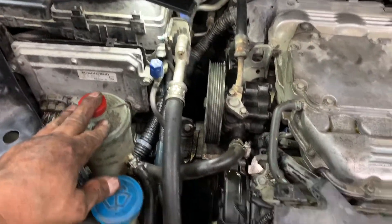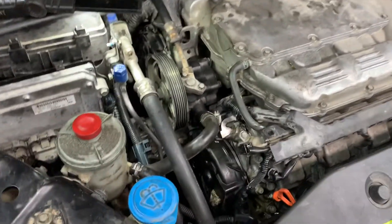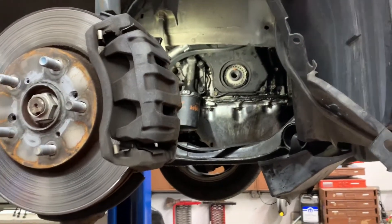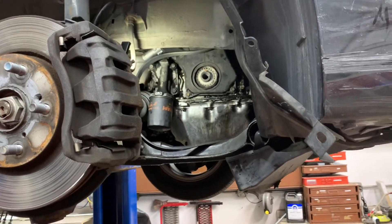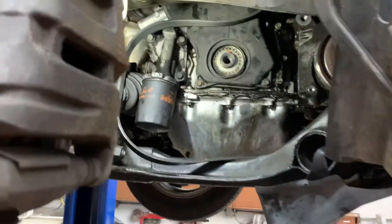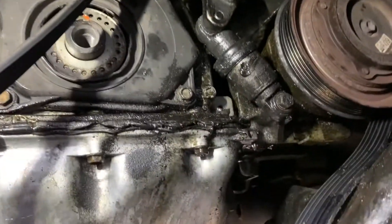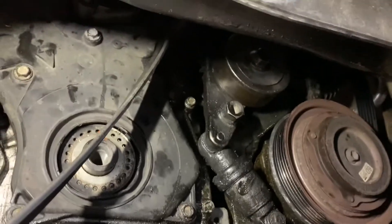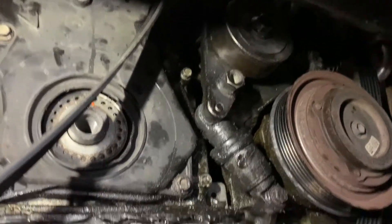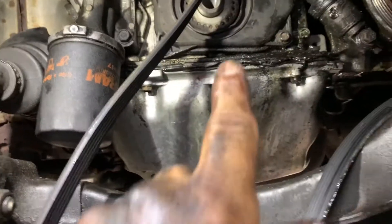Power steering pump is on. Now connect the power steering pressure hose with the 21s, then put on the reservoir. The reservoir's on, hose is connected, clamps are on. Put some fluid in it so you don't forget and aren't pumping air. Before you raise the vehicle, put the serpentine belt on the power steering pump pulley and fish the belt down below. Now put the tensioner assembly on — get the big bolt started, get the little bolt started, snug up the big bolt which is a 17 millimeter, tighten it up, then go down and tighten up your little 12 millimeter. Then put the crank pulley on.